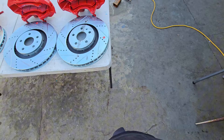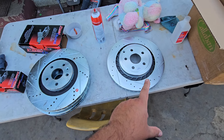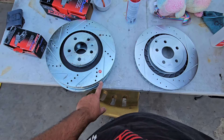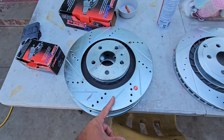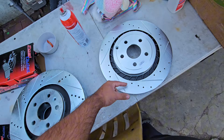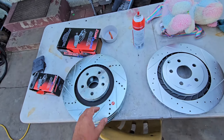If I put my front right side next to the rear from the SS sedans, they're facing opposite ways. They are designed that way — they're vented on the inside so they have to rotate a certain way. Each manufacturer has a certain way how they want their rotors vented. You can see the spline goes this way, so they want it rotating that way. I cannot put this on the left side just to make it look visually proper.